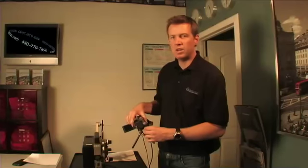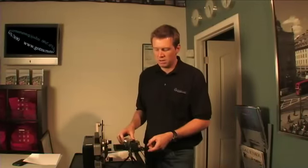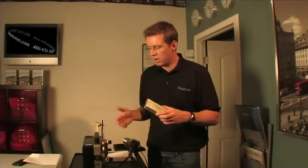We've got it going S-video out, and you can capture it to the tape inside, hit record, or if you've got a little capture box like this, a nice high quality one, it'll run you around $150 to $200, and you can save yourself a step by not having to go to DV tape. You can just import straight into your computer through your editing software. Otherwise, you just record to DV tape and then later on import that into your computer or into a set-top DVD recorder. So here we are ready to go.